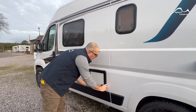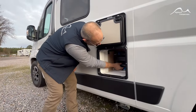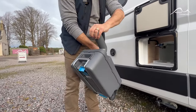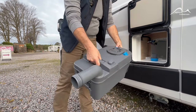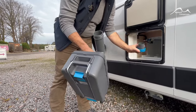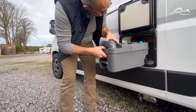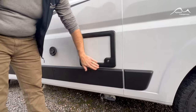On the passenger side of the vehicle you've got your toilet cassette. There's a magnetic catch just up inside here — pull up on the blue tab and you should be able to slide the whole body of the cassette out. You will need to check that the lever is shut internally. On a campsite you have collection points for these — the blue cap comes off the top. Take it over to your storage area and you can dispose of the waste by pressing in the blue button, which allows the waste to come out of the base. We always recommend using the green chemical — a cap full or a sachet or a pod mixed with about two litres of water as a starting balance for the toilet cassette. Slide the whole body back in and it locks back into position. Lock it for safety.